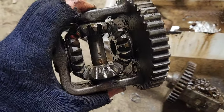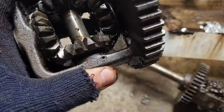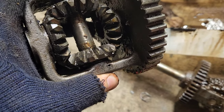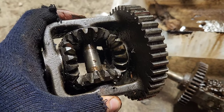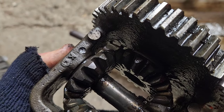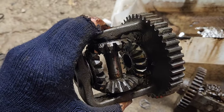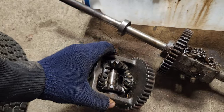The other question that's going to come up is how do you remove the spider gears in this? See that pin right there next to my thumb? You have to drill it entirely out in order to get that pin to come out, because it doesn't come out the other side — see the casting? So if you break those spider gears, life's going to suck worse for you.